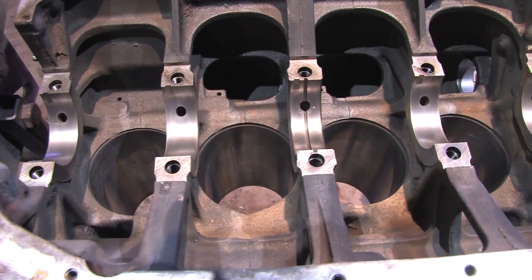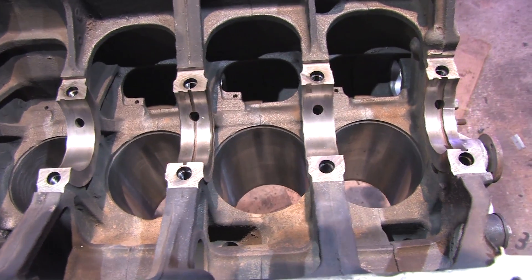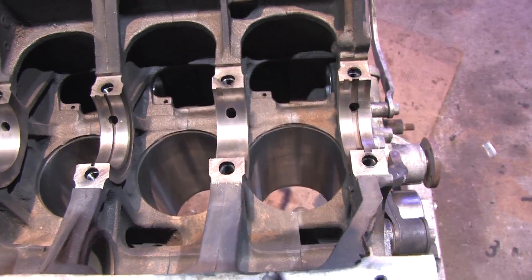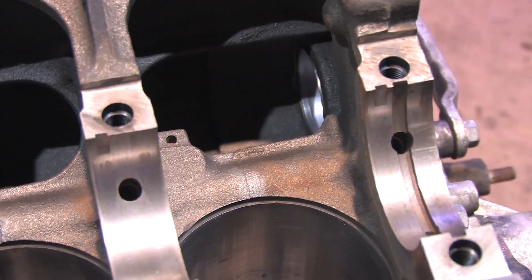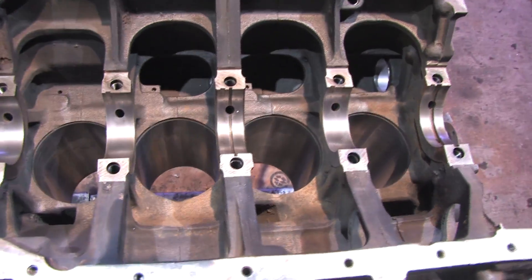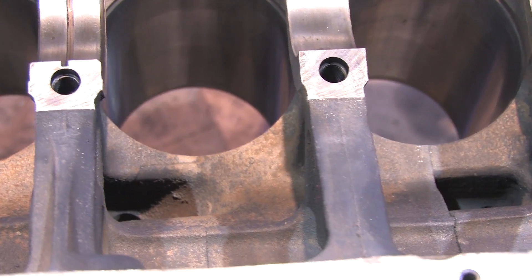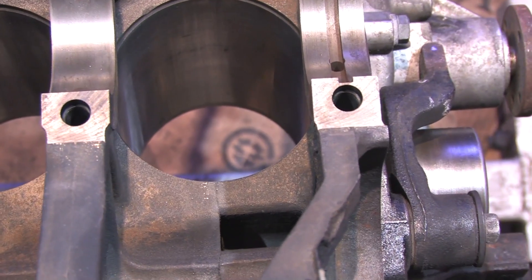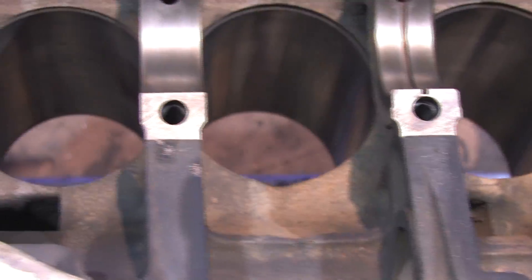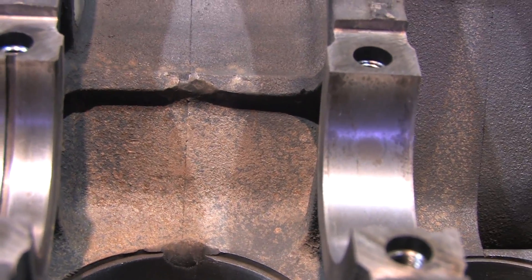With the block all oily and greasy, it was hard to see just how much rust there is inside this crankcase. Mineral spirits and air works great to dry all that up. What you see here is one of this engine's major problems that may have played a factor in its failure — rust. Not only will hot oil wash surface rust away, contributing to oil contamination, it also makes the crankcase more porous, slowing the oil flow and allowing it to trap more sludge, carbon, and dirt. A filthy crankcase immediately contaminates the oil again once it's been changed.